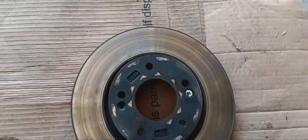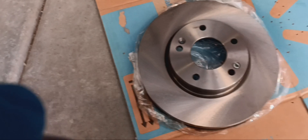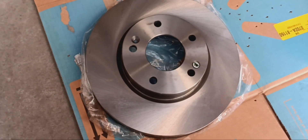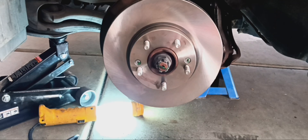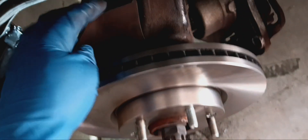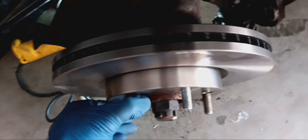Just to show you how bad these old ones looked — you can see how hot they got. There's some definite excessive heating going on. So now what we're going to do: this is the new one. I'm just using a Duralast rotor that I got from AutoZone. I like to spray them and clean them up before installing. I'm going to do the other side, put the two screws in, and get it back on the hub. Brand new rotor — just make sure you spray it all nice and clean. I already rotated it to make sure there was no dragging. I had to go back and clip up some more of what I cut and hammer it down a little bit so it stayed out of the way of the new rotor.